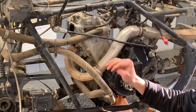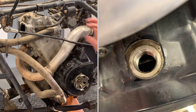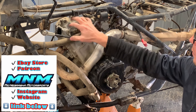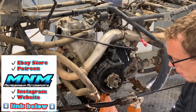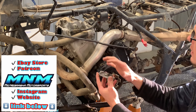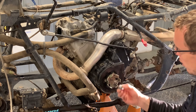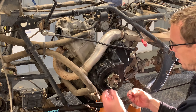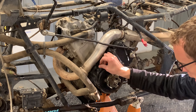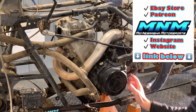Before I put these caps on, I'm going to take a couple of close-up pictures for you. Once we have everything tightened down, take your covers and put those back on — inspect those O-rings, make sure they're in good condition, and make sure they stay in place when you flip them over and put them on your cylinder head. Take your plug, making sure the brass washer is on there, snug that up, then go ahead and put your recoil pull starter back on. You are all set to go riding.